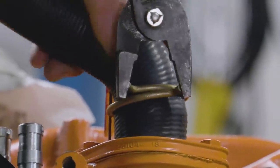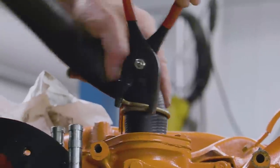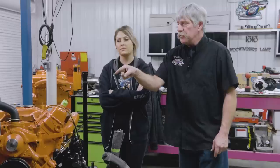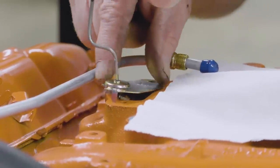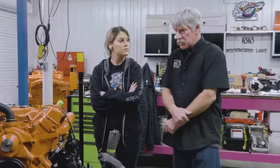I like to put this hose on here because when we put the air compressor on for the air conditioning it's almost impossible to get to this clamp. We started with the transmission, put on the starter, the fuel vapor separator, some fittings on the front of the water pump, and the choke stove for the carburetor. Now we're going to put on the carburetor, then the distributor and the plug wires.